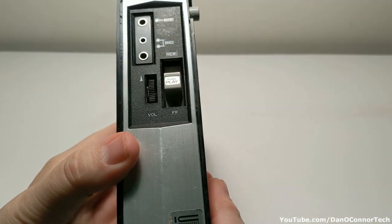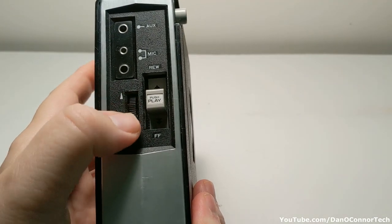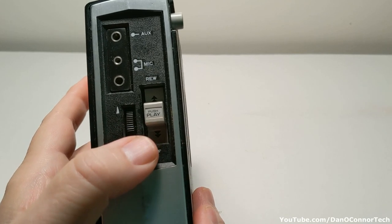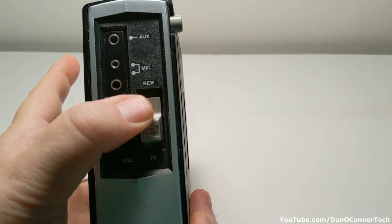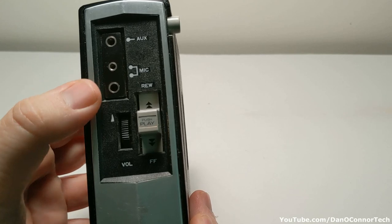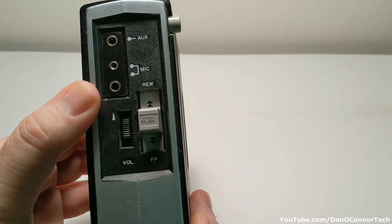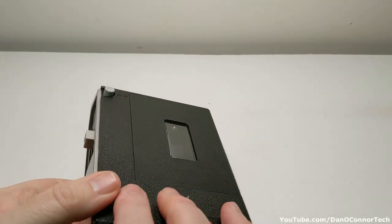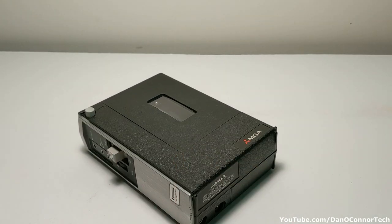Here's our controls integrated circuit — certainly dates it around 1970. Volume all the way up. Our push-to-play control. Reverse and fast forward — those don't work. Remote, microphone with remote — that does work. And an AUX in jack, which amazingly enough works. But the recording output is terrible — it's about twice as fast as it should be, and plus it just sounds bad. I've cleaned the heads and done what I can, but that's not much.